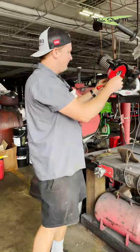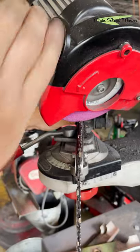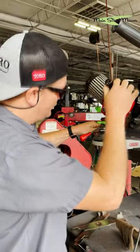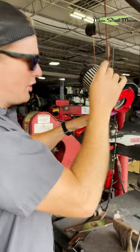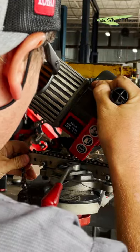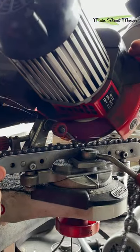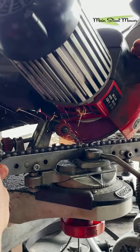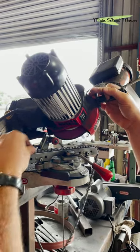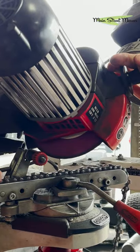It's smoking hot, so think about that heat — it's going to be bad for your nose and your bar; it's not good for anything on your chainsaw. The goal is not to take off a lot, it's just to take off a little tiny bit. This is a pretty new chain, so I don't really need to lower the raker on it — I'm just going to touch up the edge. My angle is at 30 degrees. When you're sharpening the chain, you don't want to go too deep because you can mess up the actual link of the chain and compromise its integrity.